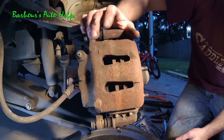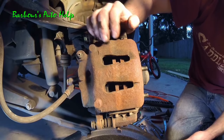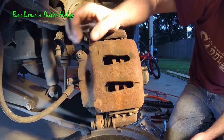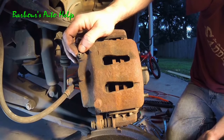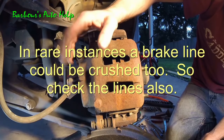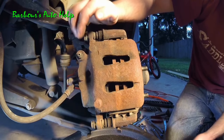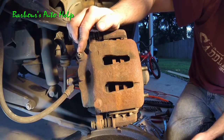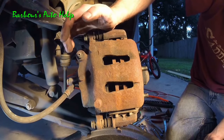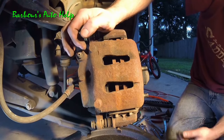But if you have a single-piston type of caliper and you're curious whether the hose is clogged and preventing brake fluid from going back in, a simple test: loosen the bleeder valve here just a little bit, then try to collapse that piston. If the piston goes right in and brake fluid starts squirting out, you know your hose is clogged and it's not your caliper — you need a hose. However, I'll jump in here with a caveat: it's not quite that simple. Further testing is needed to confirm the hose has actually failed, and I do go into that in the linked video in the description.